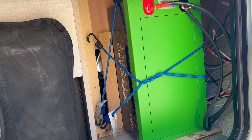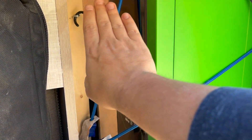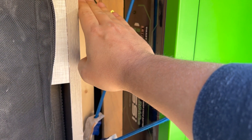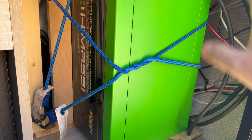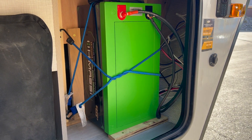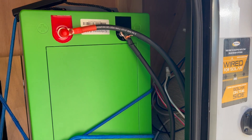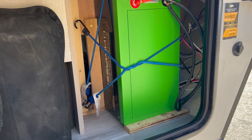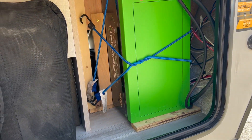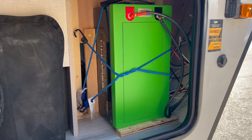The other thing I had to figure out was where to place it. This is what it looks like on the passenger side of the pass-through. In order to put it here I had to remove two thin panels — one that went across from the back to the front, and one that was the other direction. They put those in there to hide all the wiring. I removed those panels so I got more space and didn't have to deal with panels every time I needed to get in and work on the trailer's power. Whatever you do with your batteries, make sure you create some bracketing so the battery doesn't flip-flop on the road — these are heavy batteries and you don't want them banging into your trailer without any support.